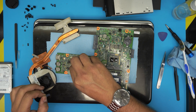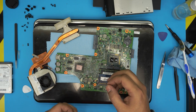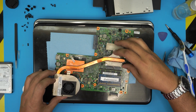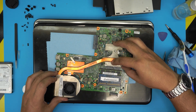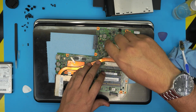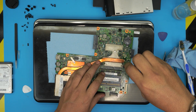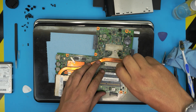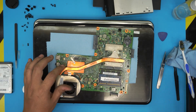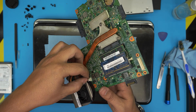Make sure you remove the plastic film on both sides of the thermal pad. Grab the heat sink and bring it on evenly, align it, hold it down, and tighten the screws. There are numbers on the screws — one, two, three, four — so follow the sequence. Don't forget the heat sink screw for the GPU. You do not need to remove the pads for the VRAMs. Make sure you connect your fan cable — this is very important.